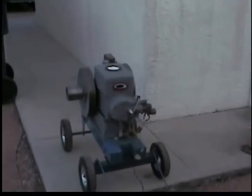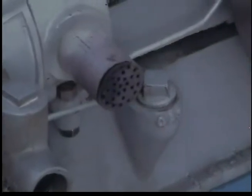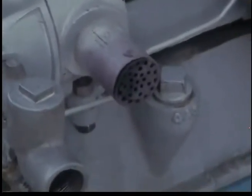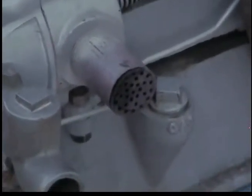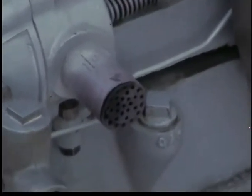You can see a little bit of the white smoke there. It's kind of hard against that white background, but maybe if you get up there and you point it at the exhaust pipe, you might be able to see a little bit of white in the smoke. A little bit. So what I'm going to do is top off that fuel with more and more SeaFoam so you get less gasoline, more SeaFoam in the mixture. We're going to see if we can keep it running.